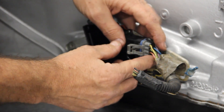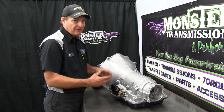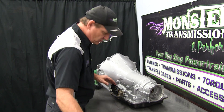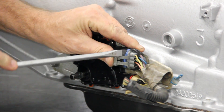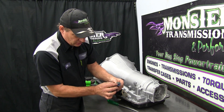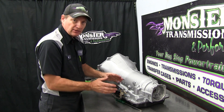Next you have the actual harness. Here we show the harness where it's still connected to the neutral safety switch. GM used to create a watertight seal — they add rubber silicone to these connectors. After years of being in the vehicle, it's very difficult to remove the harness from the neutral switch, and usually what happens is you break the switch trying to remove it. We suggest you remove the clip and gently pry top and bottom to remove the harness. You can still remove the linkage and the neutral safety switch without removing the harness.